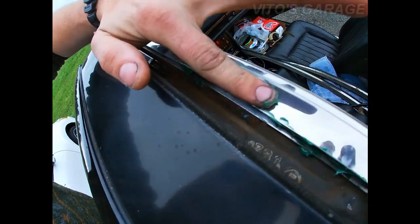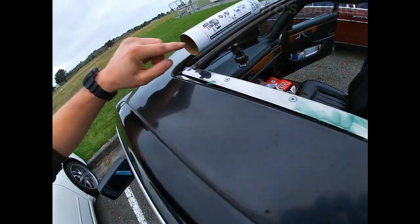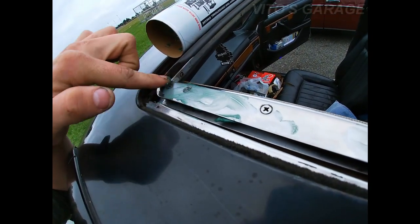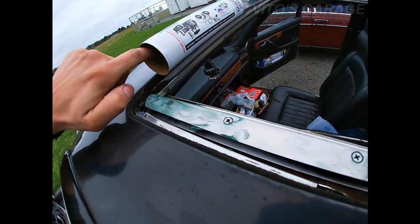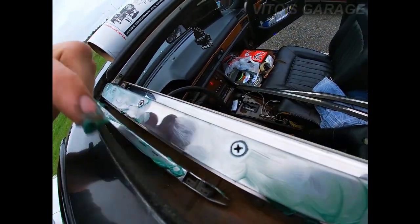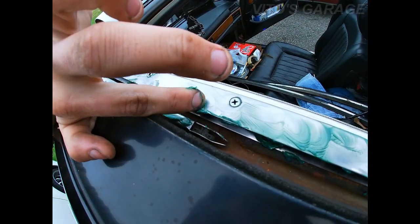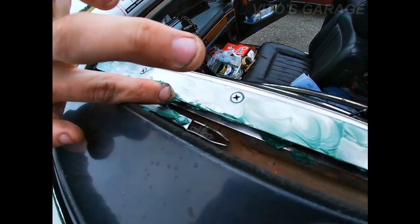You can put some on this surface too for rust prevention, because the bolts and fasteners can rust. But the main thing is to get grease under there in that track. If you have a Q-tip, that's really helpful because it can push grease deep in there. In this case I'm gonna use my plastic tool to push all the grease inside those tracks.